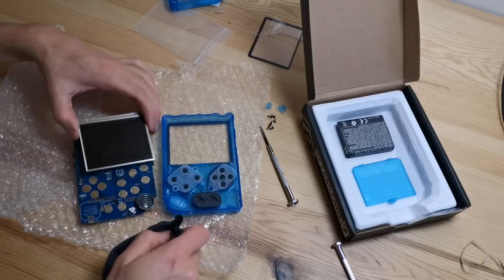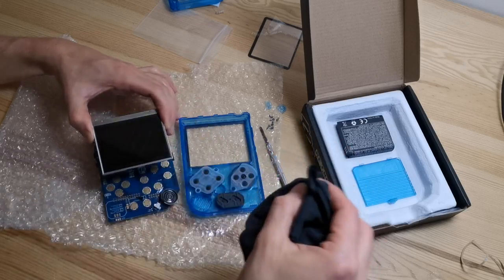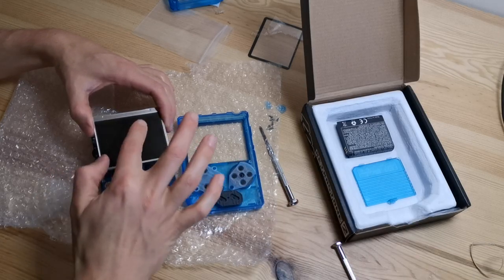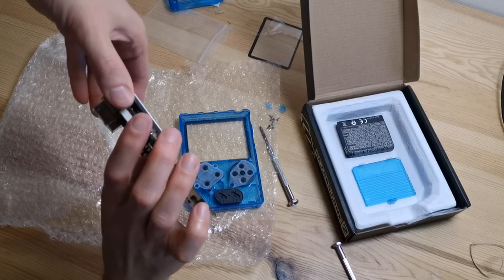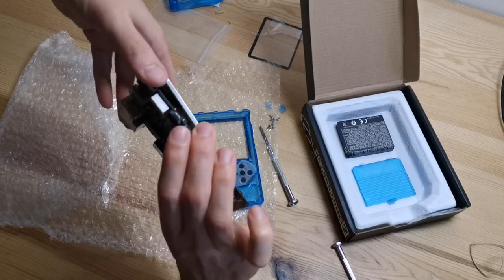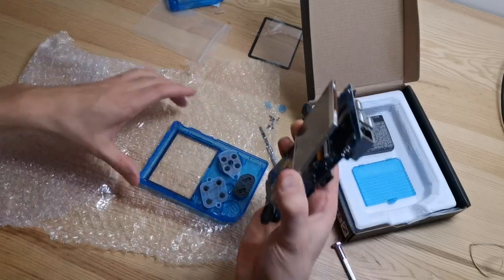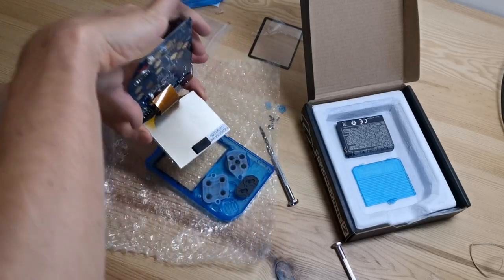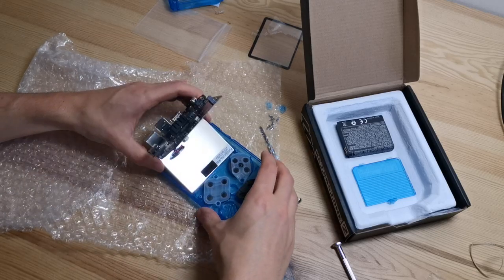You shouldn't put your fingers on the LCD because you'll get marks. Hold the PCB and the LCD together with your fingers holding both, and put back the PCB. Hold the LCD and place it down into the cavity. You have to keep the PCB close because the ribbon is not very long. The idea is to put the LCD inside its cavity, so just press it in.